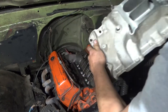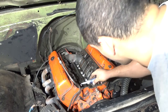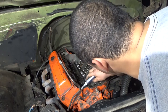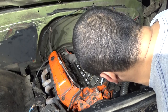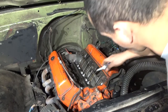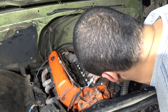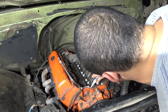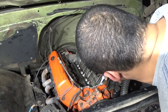Here's my intake — notice how clean it is. I scraped off every last bit of gasket material. It's always best to use a dull scraper so you don't cut into the aluminum. When applying the gasket maker it's best to leave a pretty good-sized blob on each corner because that's where they like to leak. After that I'm going to run about a quarter-inch bead across the top. I kind of mess it up a bit so I smooth it with my hands, but either way it'll be fine.